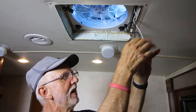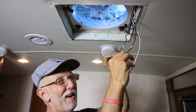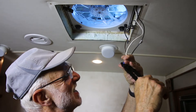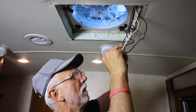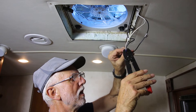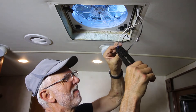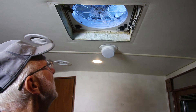Going to our Fantastic Fan — the black wire is the positive, and even though it's brown, that is the positive. Getting about the right connection length — I've got plenty of room in the styrofoam insulation up there to work with. Keep it as safe as possible. Now the other side — that fits very nicely with the negative side. Crimp with the blue connector, a second crimp a little more toward the center, and a third for good measure. Give it a tug — looks good.